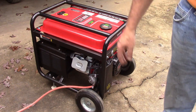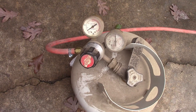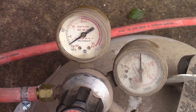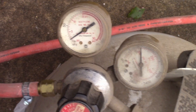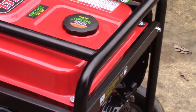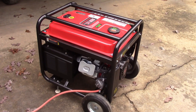The reason I couldn't get it started was I had the acetylene regulator set on almost five and I was flooding it. I got it set on like one pound, because a propane regulator is around six ounces — it's hardly anything. I just had it set too rich. Now that I've got it set right, let's pull it one more time and see what we get — should fire right up.